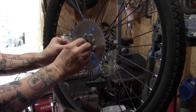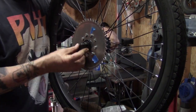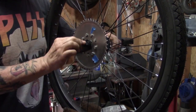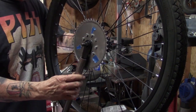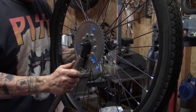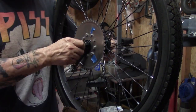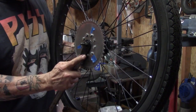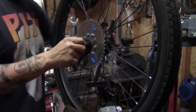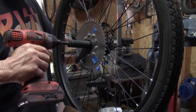Let's go ahead and mount the brake arm onto the anchor cone - you've got the thick flat washer and then the locking nut. I'm going to use a section of pipe and my impact tool to get it tight. Take your time with this - go through it three or four times, spin it around a few times. If it's too tight, loosen it up; if it's too loose, tighten it up a little bit. Just tightening that bolt can move the axle shaft and change how tight the bearings are. Double-check, triple-check your work. Make sure the bearings are not bound up and not too loose.